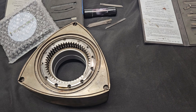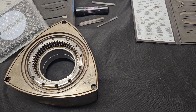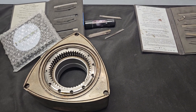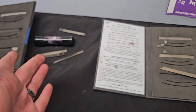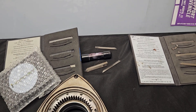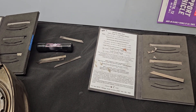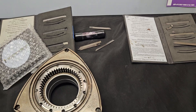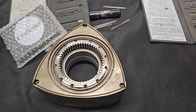Now, if you're going boosted, NOS, power adder, or supercharger, then the Renesis motor — or any motor — might be more prone to detonation, and you might be running more exotic fuels. The expected lifespan is probably less than 80,000 to 120,000 miles, in which case I would jump to most aftermarket steel seals, like E&Js, iRotary — E&J being my preference — but there's a lot of other good seals out there: Power Seal, and others. Do your research and check out all those options, because they do serve a purpose in high performance and modified engines, especially the seals that don't shatter. But that's not what's going to make the general RX-8 engine last longer in OEM configuration.